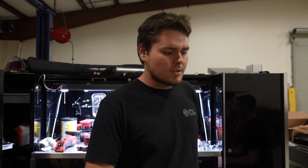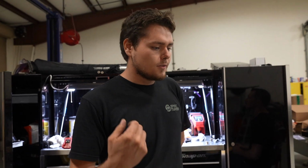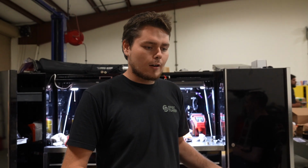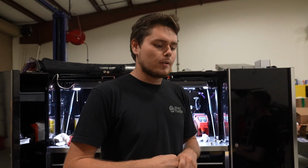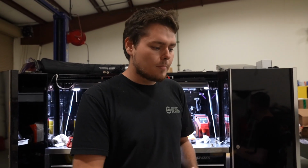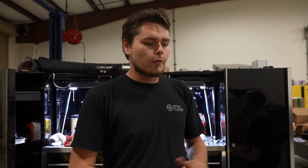Yeah, so due to the ride height of the car and suspension arm angle, it has a lot of anti-squat in it, and that gives you a very fast straight line car. This is probably one of the fastest cars from leaving the chicane up until initiation. But then Adam would always complain the car has no side bite. We would do things to increase side bite with zero change really, visually and from Adam's feedback. So having that much anti-squat is not good for a drift car, great for a drag car.